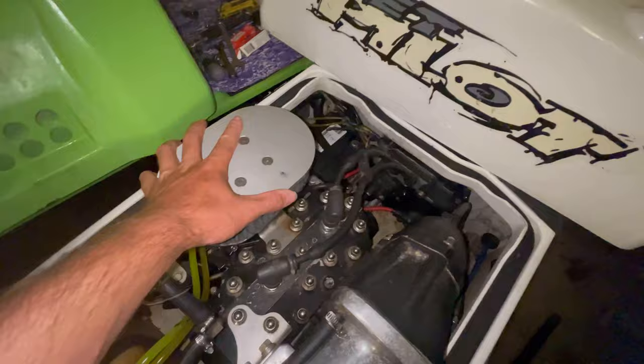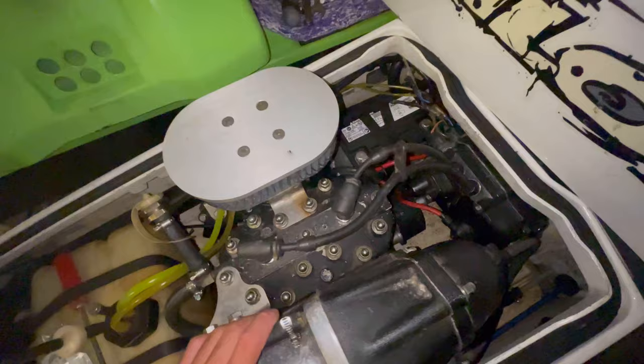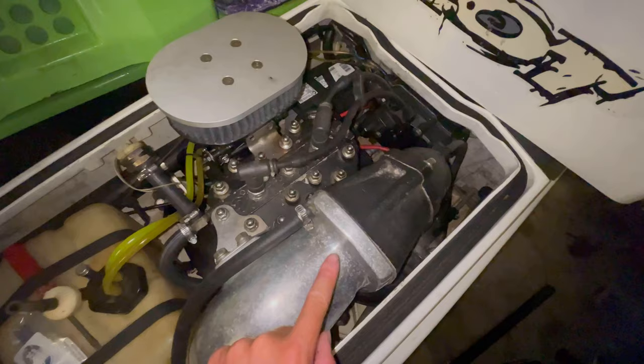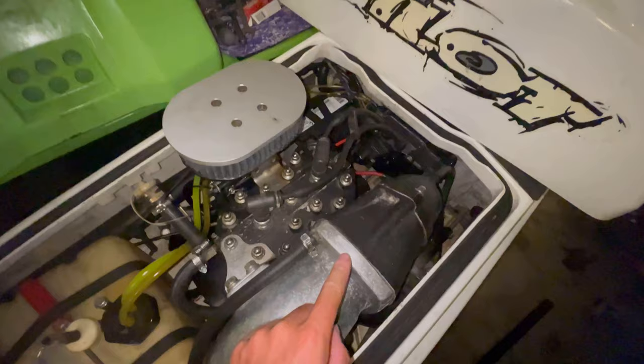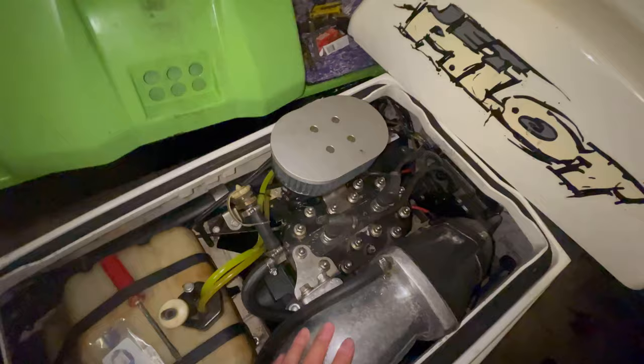That's definitely been in some salt water. So I pulled the pipe off, pulled the manifold off, pulled all the hoses. I probably shop vac'd maybe 2 pounds of sand out of this whole system. It was clogged. If you have a Coffman's pipe, big tip, make sure that pinhole right about here on the top of the half pipe is clear. Mine was full of sand and soot. Even after only a minute of this thing running, any drop of water on this half pipe would sizzle and boil right off. Make sure that hole's clear to keep this cool.